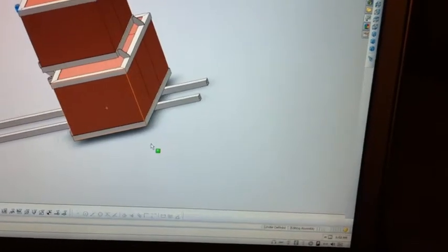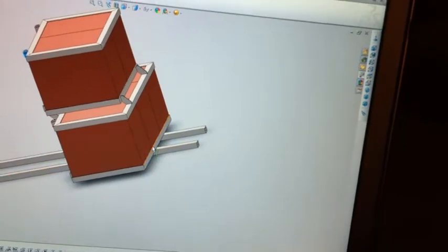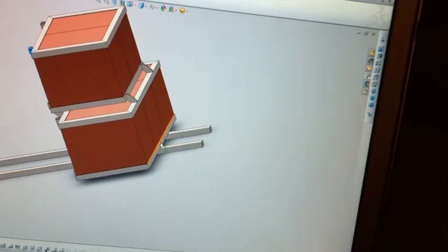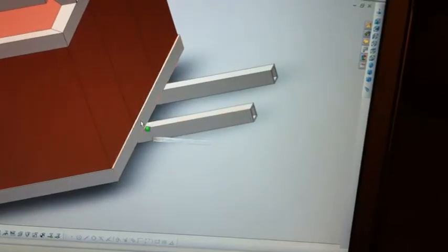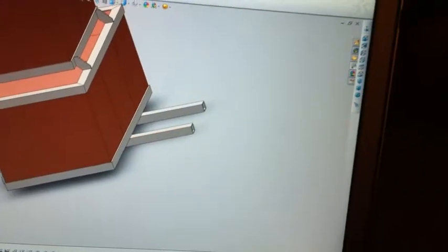And then if you have room, I'd recommend taking some extra material, cutting an angle on it, and welding it onto this lower battery tray here, coming angled upwards, connecting into even just this small radiator mount here. It would just add strength to it. Just to have a diagonal, it would look something like that down to the battery tray.